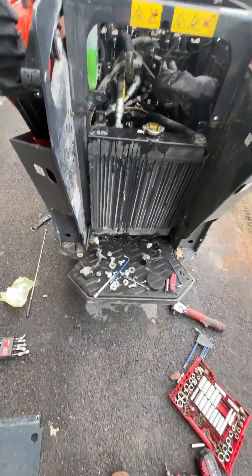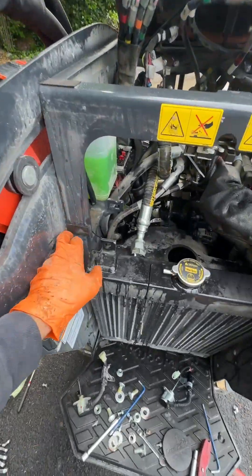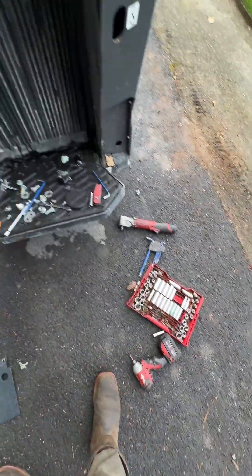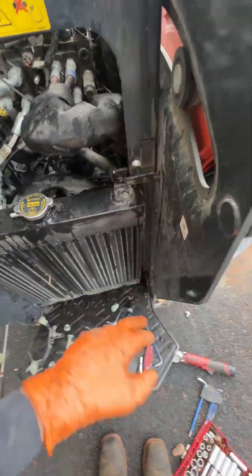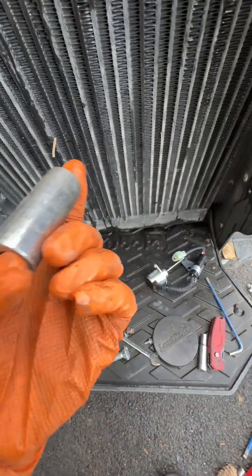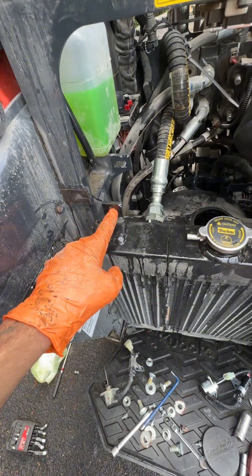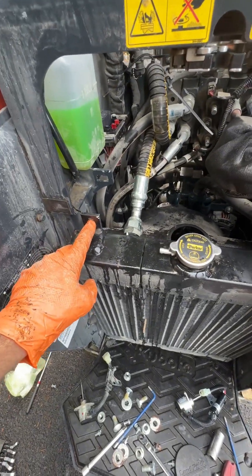What you have to do is that guy just flops down and then lifts off these studs — they're just hooks. Then there's this cover, which looks like it's standard, so it'd be a three-eighths socket. There are three bolts on the bottom and this shroud came out. This has four bolts on the side — one, two, three, four — and you get the nuts from the outside, so that's going to be a wrench and a socket. Then you take your big socket, which I think is 19mm or three-quarter, and you're going to take these big carriage bolts — or fender bolts — out.